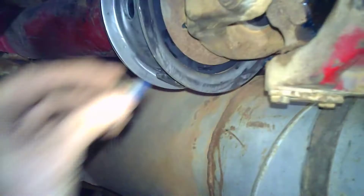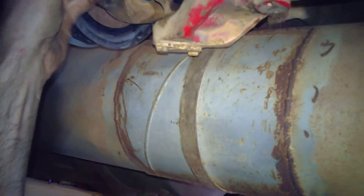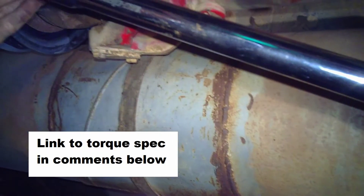Fit the unicap bolts. You should only use these bolts once — replace them new every time you take them out. In this case I didn't have new ones and needed to get it back together, so I reused them. Put plenty of Loctite on them and make sure you torque them down.